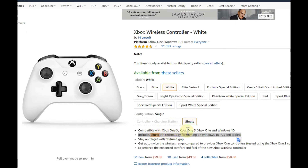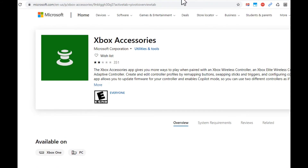If you have the new Xbox One or Xbox One S controllers and are having problems, there are solutions. One is to download the Xbox Accessories app from the Microsoft Store on Windows 10. With it, you can update your controller firmware using a USB cable. I've heard it's also helpful to use USB 2.0 or 3.0 for the update. This may solve the issue.